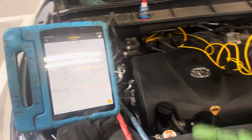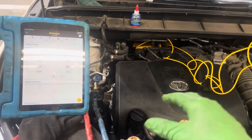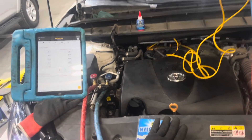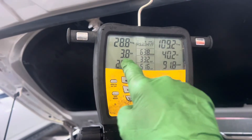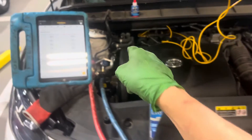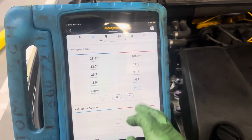This is a good example. Under some vehicles at different temperatures and pressures, things behave differently — some almost have no change at these lower temperatures. You just have to do several thousand cars; you'll learn it faster than that, a few hundred. You can see the superheat, you can see the sub-cooling — we're up to 40 now. That's how much work the internal heat exchanger is doing on this vehicle. We went from 20-something to 40.